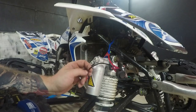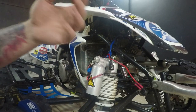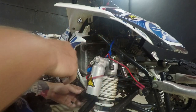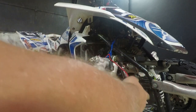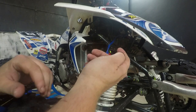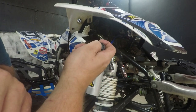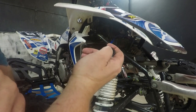I also noticed the cranking power of the engine was kind of brought down. We're having more power draw on the fan, so what I've done is I also put the fan on a switch. So that's your ignition on. When you're cranking the bike, have that switch off. Then when you go to turn it over, or when the bike is running, you have your switch on there.